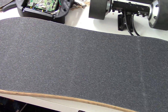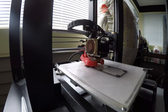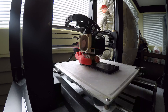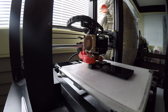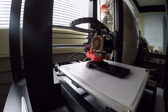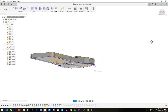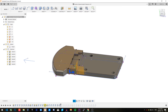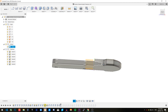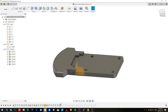For my longboard I used a bamboo composite deck that was custom made based on the Loaded Vanguard shape, as that was the most popular option in the electric skateboard community — thanks to Boosted using them in the first and second generation Boosted Boards. The deck is pretty flexy but not as flexible as the Loaded Vanguard, which to me is the perfect amount. I also modeled a bash guard in Fusion 360 and 3D printed it to protect my deck from wearing when I stand the board upright — printed at 0.25mm layer height at 20% infill in PETG.